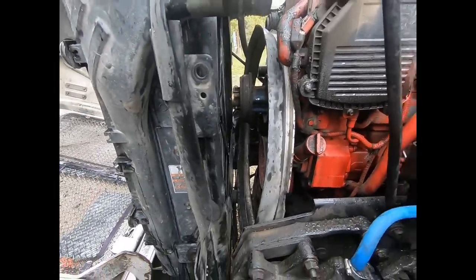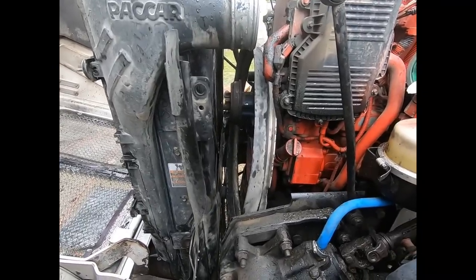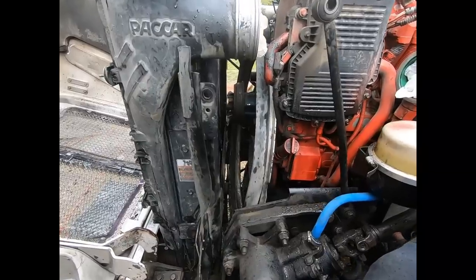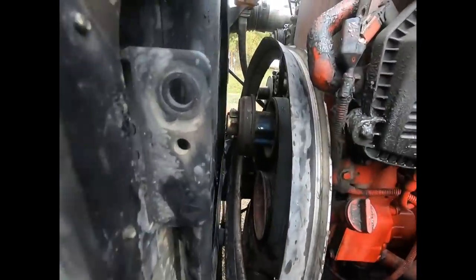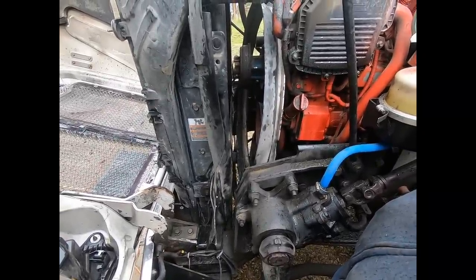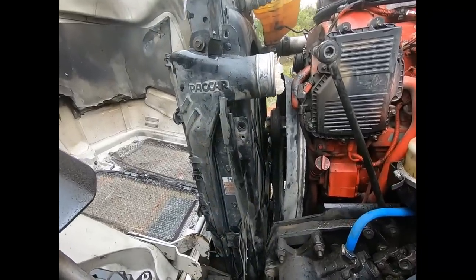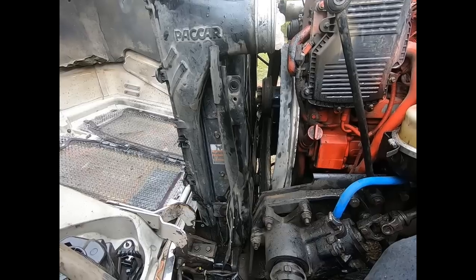Here's a little trick — there are some holes through that hub where you have to get to the inside to get this thing dismounted. The clutch needed to turn about half an inch to get the holes to line up so we can get a wrench through there. I've got a pry bar wedged in there, and we put big channel locks on the center hub — the blue part. Two of us doing this: one held the hub, the other took the pry bar and just turned a little bit to get those holes to line up. We pulled the fan blade out and pushed the radiator ahead — see how that moves now? That gave us enough room.